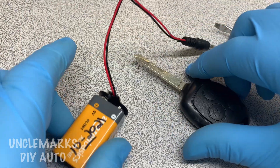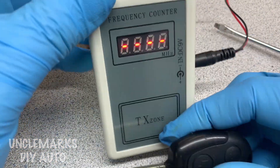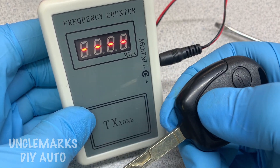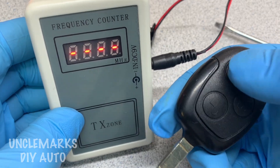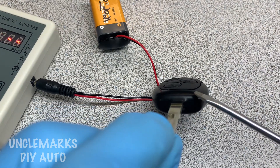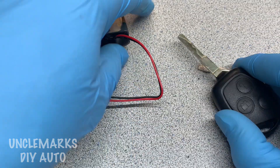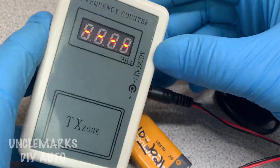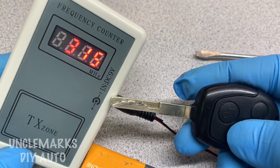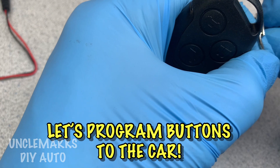If you're ever testing one of these, I'll link a tester in the description. If you want to know if the buttons are actually sending a signal, this is a signal catcher tester — press the button and it says 315 megahertz. That's for the US and Canadian side. At least when you press them you can see it is sending a signal. The dealer said they didn't know if it was the key or the receiver in the car. This handy little gadget will help — they're really cheap.